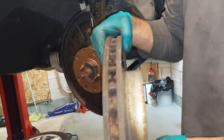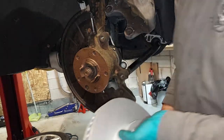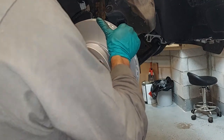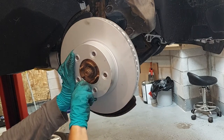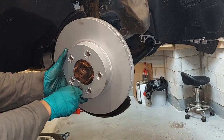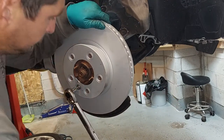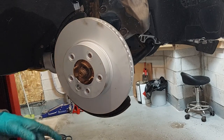This would be the front right axle. Confirm the direction of the vanes and match it with your new one. Also use your guide online to confirm that the previous mechanic did not install it incorrectly. Torque value on this rotor hold-down screw is 15 foot-pounds. Make sure your rotor is nice and centered. Torque it. Now we can work on our caliper.